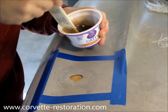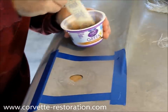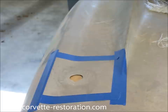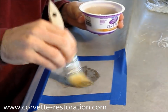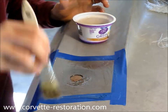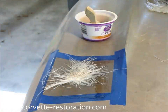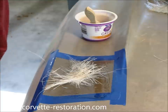I have my resin. I put the hardener in it and mix this very well — better than you think you need to. Once it's mixed, I'm going to start priming the area to receive the fiberglass. By priming it, I mean I actually put down just a layer of resin on the repair area itself and around on the surrounding fiberglass. This makes sure I get a really good bond on that first surface and I don't end up with any delaminations down the road. I should have gloves on for this because you'll end up with fiberglass on your hands otherwise — it makes quite a mess.